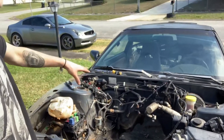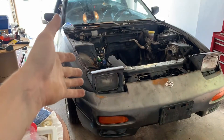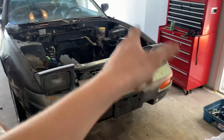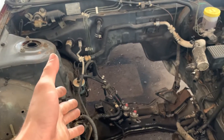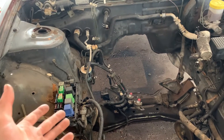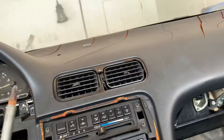Basically all this stuff has to come out and go into my coupe, so I just have to make sure I take it out and remember how it goes in. So I got the 240 in the garage — I put a comforter on the back bumper and pushed it in with the SC300. It worked very well. Now that I have that in here it's the next day, so I'm going to pull off the fenders and the bumper and start pulling out the chassis harness. Then I'm going to pull off as much of the fuel system as I can because I don't think my car even has fuel hard lines to run. Time to remove the original radio, the AC stuff, the cluster, the dashboard, and then the harness.